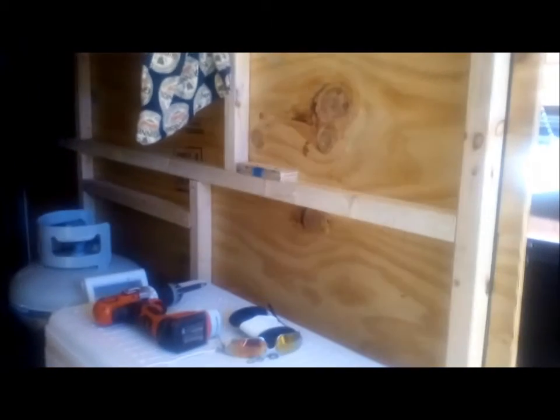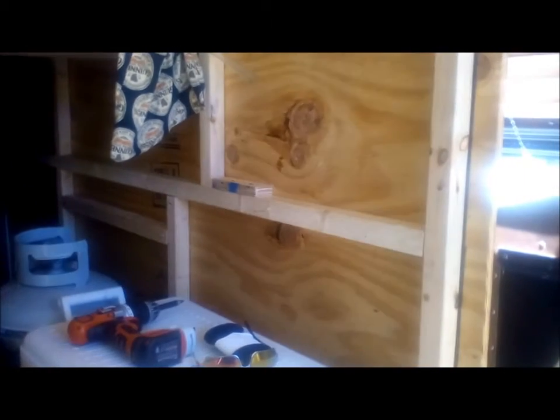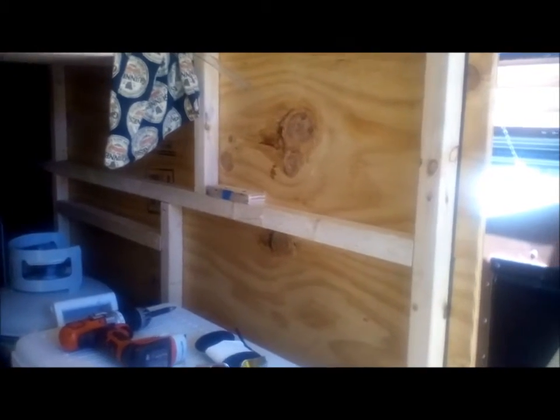Now before I fold it, I'll show you how it's mounted. It's kind of dark, but as you can see, that piano hinge that came with the lid that was attached to the toolbox, I just used a small piece of aluminum stripping behind it to space the hinge so it fit flat against the trailer. And then on the bracing on the inside of the trailer, I had this 2x2 that I ran from front to back, and that supports the wall from bowing, and it also gives a mount for the lid on the outside, so you really have a lot of support.